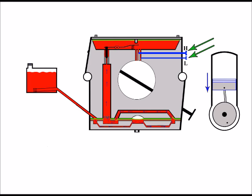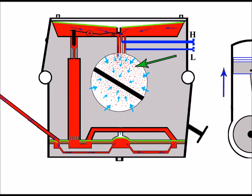Now I've briefly explained what they do, I can better explain how problems with mixture screws can cause bogging down. Usually, but not always, any problems with mixture screws and bogging down is due to incorrect settings. If the mixture screws are set correctly, we'll have a good ratio of air to fuel in the inlet there. The fuel is shown as red dots, and the air is shown as blue arrows. The fuel is separated into little molecules because it's been atomized by the air rushing in through to the engine. So it's nicely separated, ready to be burnt in the engine for combustion.